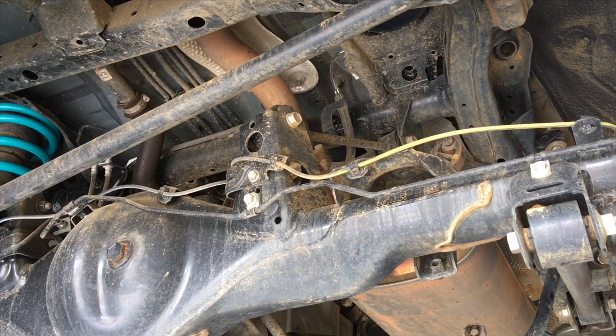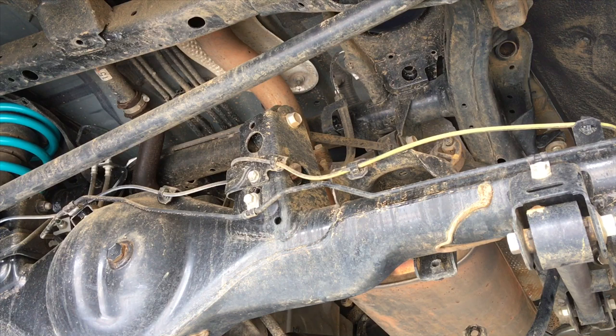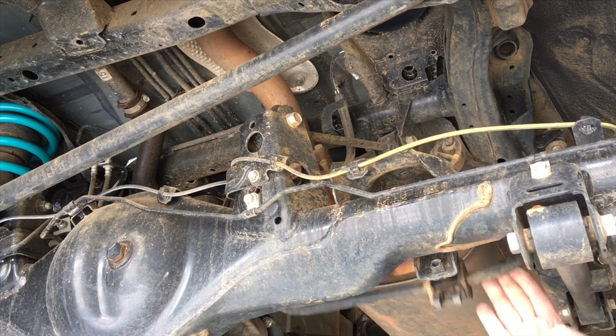we need to reuse the spring top outs. That's these in the top of the springs. Don't really like cutting those out, removing them and putting airbags in, but you can do stuff like that if you want. It's up to you. Depends on your spring selection, and if you get the height you want, it can be a suitable solution for some people.